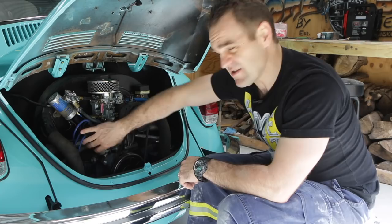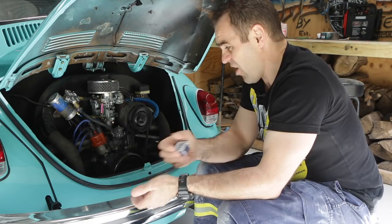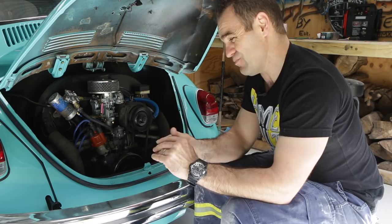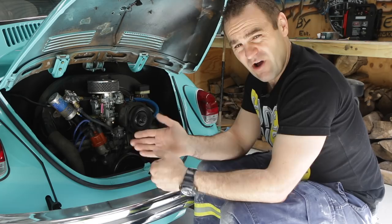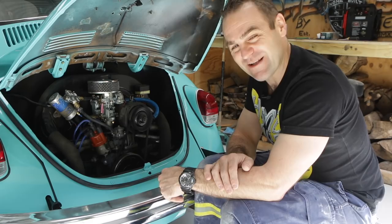The timing at the time was okay, but I noticed that the distributor is actually loose — not super loose, reasonably tight, but loose enough that it's obviously just moved out over time. I rechecked the timing and I was only running 27 degrees advanced at 3000 RPM, and it should be 32, so it was quite retarded.